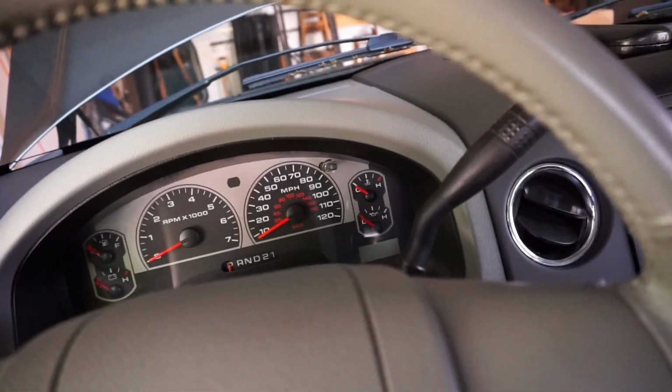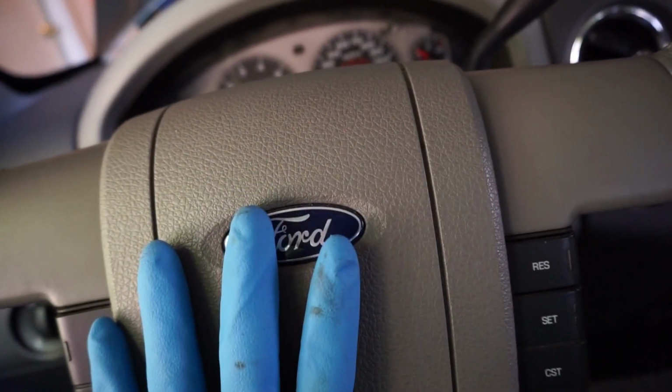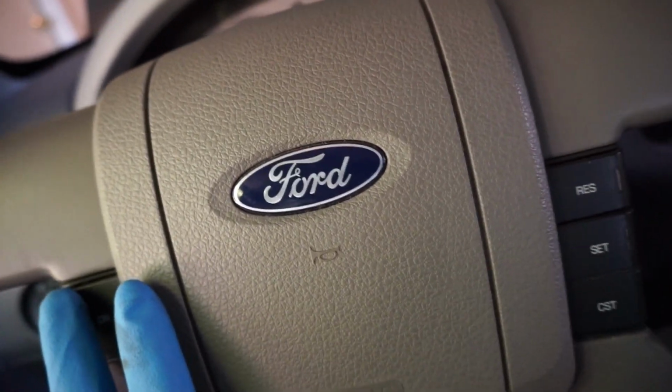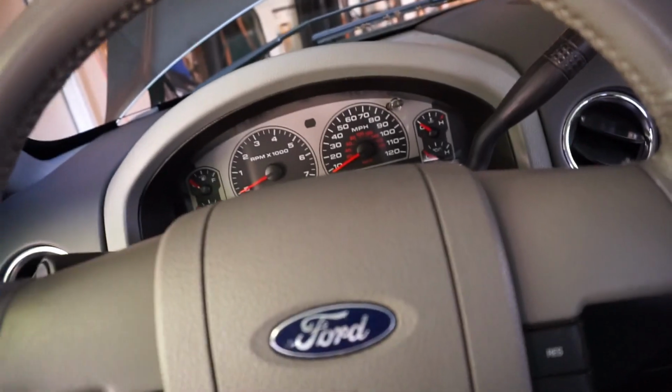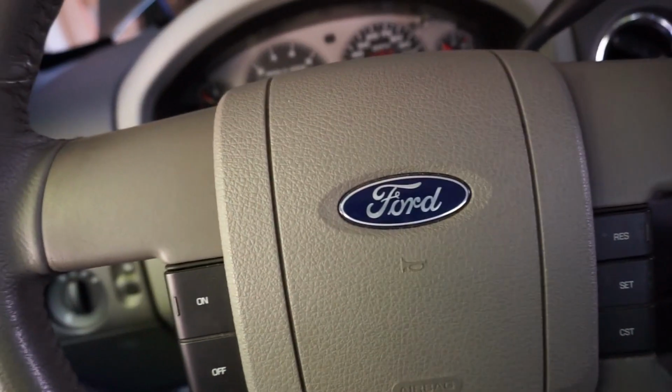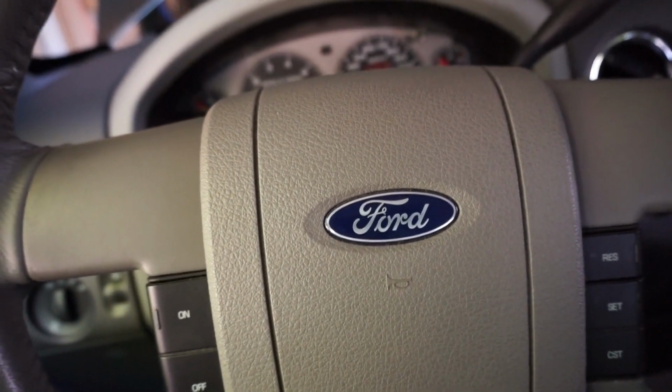And remember that you got a clock spring in the steering wheel, so you need to be holding the steering wheel in place. So you can use bungee cord to hold it in place, but remember the bolts, you need to put it at an angle where you can access the bolts.